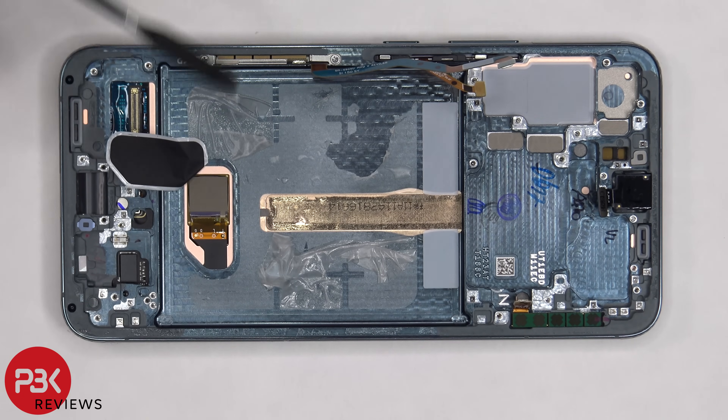Here's a better look at the screen. The fingerprint sensor is located here, and there's a cutout on the screen on the top for the proximity sensor. If the screen flex cable is over here and you pry your screen off from the front without disassembling the back, when you're applying your new screen you're going to have to align the connector with the flex cable since there isn't much movement, so you just get your screen, line it up correctly, and then press down to make sure it connects.